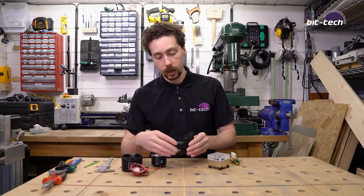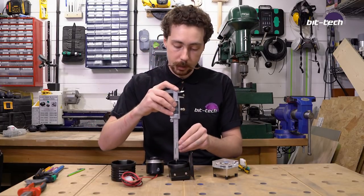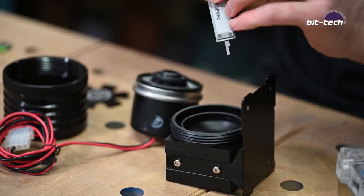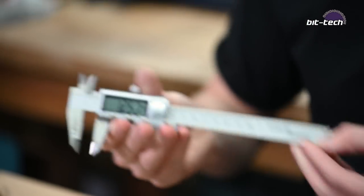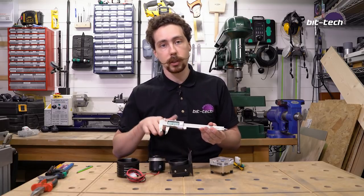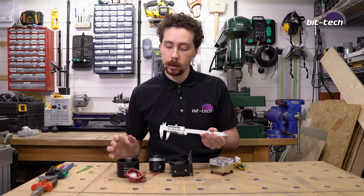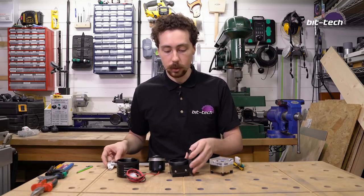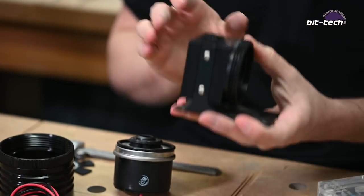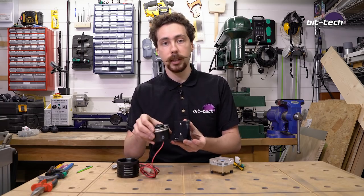To measure, you take your calipers and measure down to the center — on this one 12.5 millimeters. When I'm designing my own D5 mounts I tend to use 12 millimeters as the depth, which means you have to use something like 15 or 20 millimeter thick acrylic. The acetal on this one is about 30 millimeters thick plus it has the mount on the back. So to give you an idea, if you're using a distro plate it's going to have to be thicker if you're going to be using a D5.